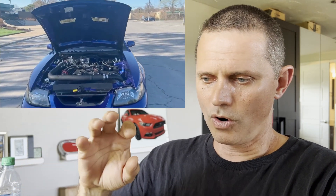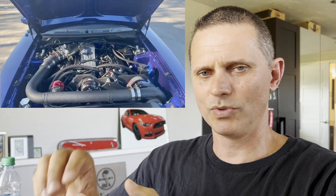I'm remotely tuning this car, so I can't see it in person, I can't hear it — I'm relying on the data. So I really have to do my due diligence and dig through all the bits of data I can find: pulse widths, MAP data, air-fuel ratio on the other bank, and compare them. That's exactly what I did, so let's look at the second bank of cylinders.